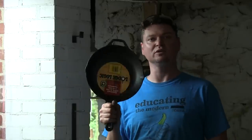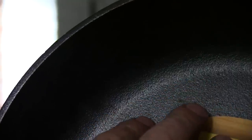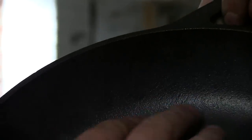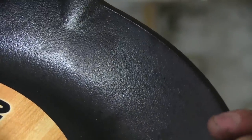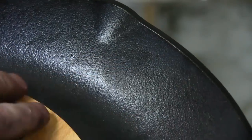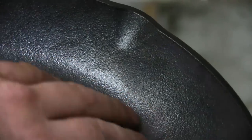What I'm going to do right now is teach you the process. I've got a brand new Lodge cast iron skillet right here. You can see all the pits and imperfections in the casting — these things are sand casted, and all this is just a lack of sanding smooth. That's the only reason your Lodge is considered inferior to old Griswolds and Wagnerwares. Lodge also produced a lot of really high quality cast iron back in the day — the only difference was that they actually sanded it. That's what I'm going to do here today.